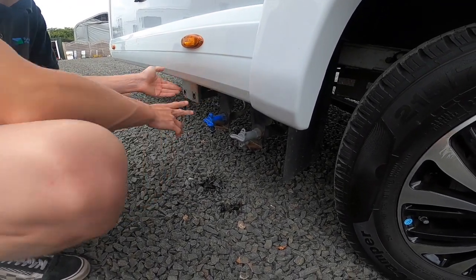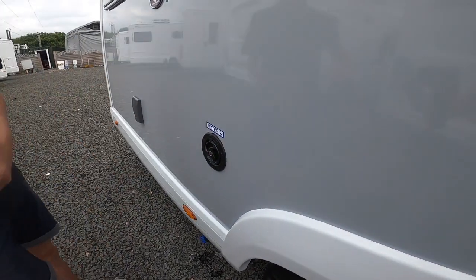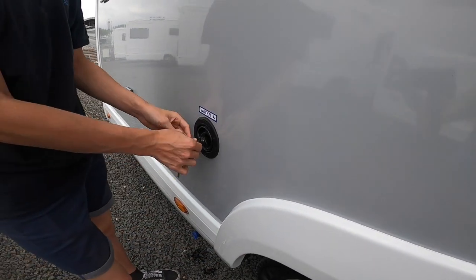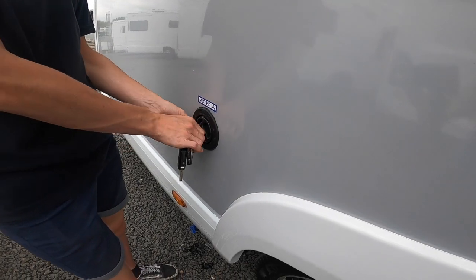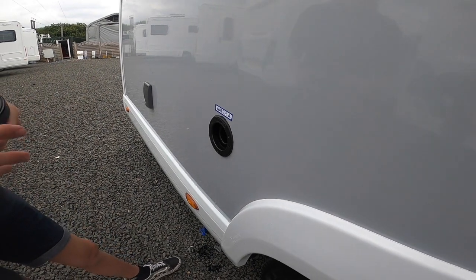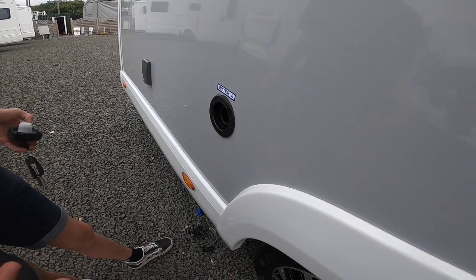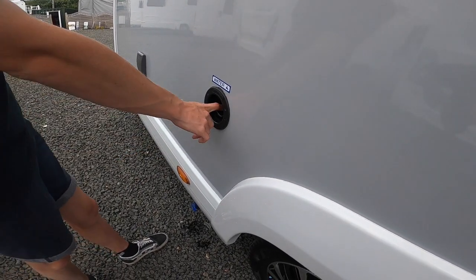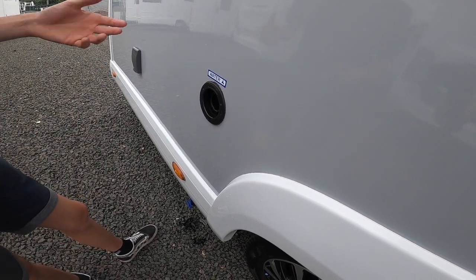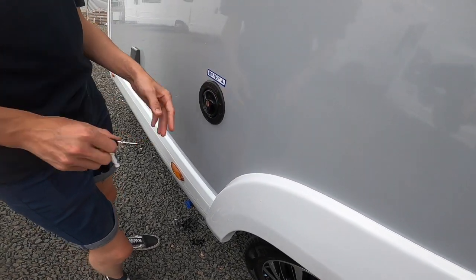Here is your flue for your water heater. Above you've got your water intake — one of these keys does the water, one does the habitation door. It's a lockable cap, push it in and turn. I'd go and buy a hose pipe, doesn't matter if it's a collapsible one or a normal hose pipe, as long as it hasn't been used in the garden. You'll want some hose ends and you simply put the end in there, wait until it overflows which means you've got a full tank, or until you're happy you've got enough water on board. You will need connections with the hose as it's mainly just a brass tap on most campsites.